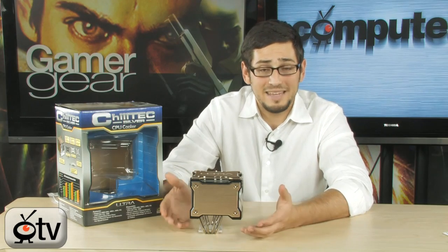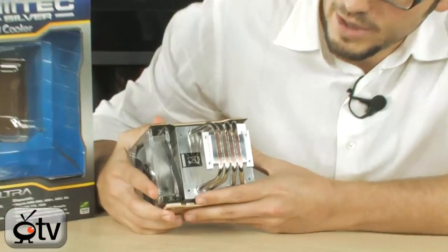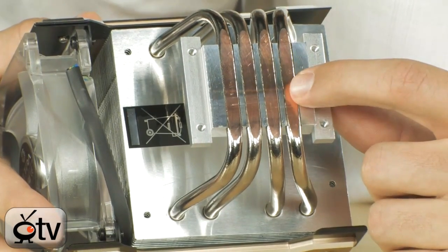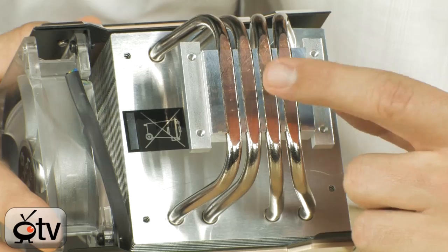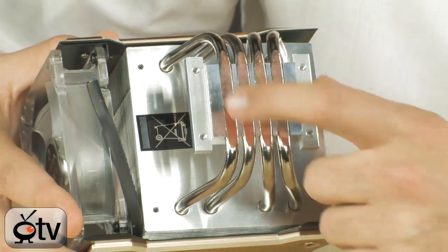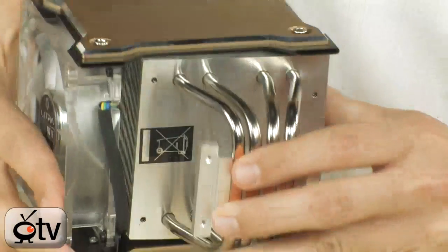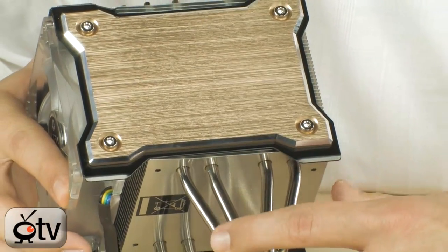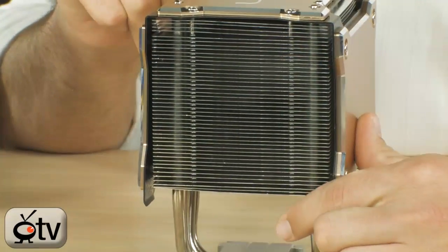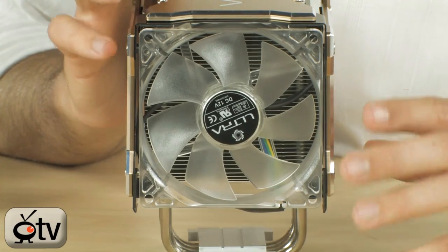It's got four gas-filled heat pipes with an exposed copper core on the CPU block, which transfers the most heat from your CPU's heat spreader into the heat pipes and up through the cooler. When the liquid down in the heat pipes gets hot, it turns into a gas, evaporates, and travels up through the sealed pipes. That increases the pressure, moves the heat up into the cooling fins, and then the fan pushes cold air through to cool everything down.